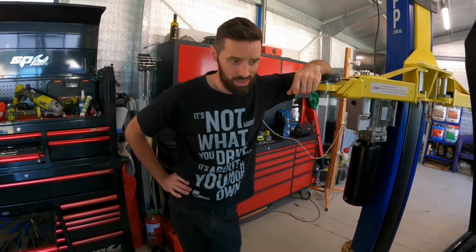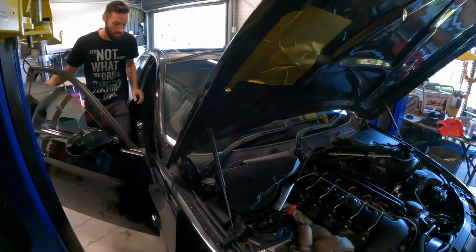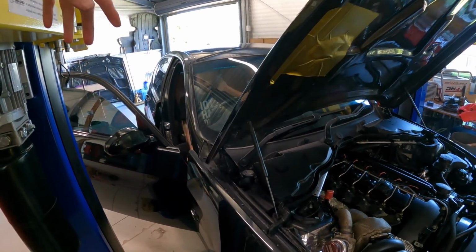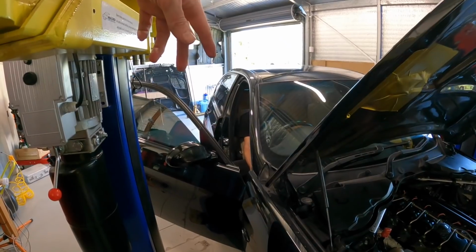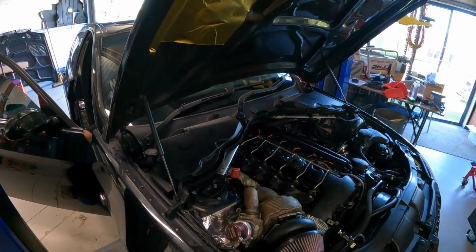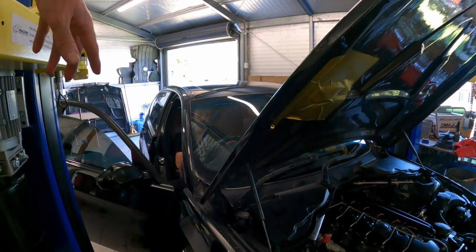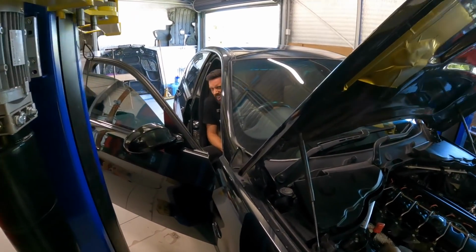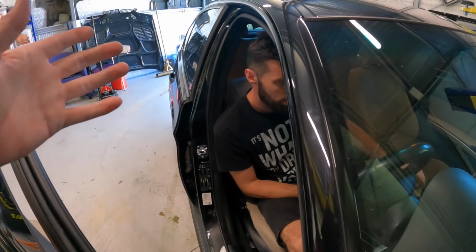All right, let's see if it starts, because we've had all the ignition apart. I did have the fuel pump disconnected so that we could do the compression test. Maybe prime it, turn the ignition on, then off to give it a bit of fuel pressure. I bet you still got a bit of fuel in the cylinders, actually. Ready? Yep. Fired straight up. Does it rev any different? It's really smooth. Alright, let's take a drive.